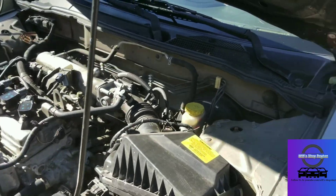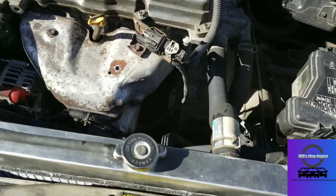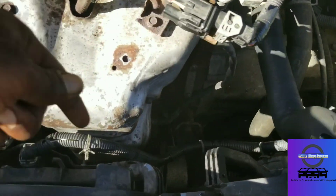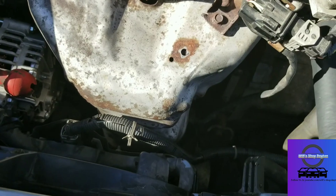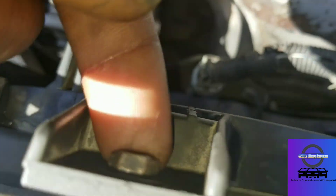And that is how you change the radiator on a 2004 Nissan Sentra 1.8. Hope I covered it well enough. To run over it real quick: two hoses, two transmission line hoses to disconnect, and the fan which is two 10mm bolts.